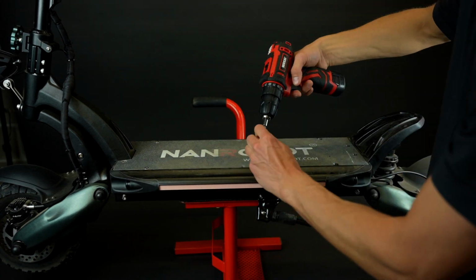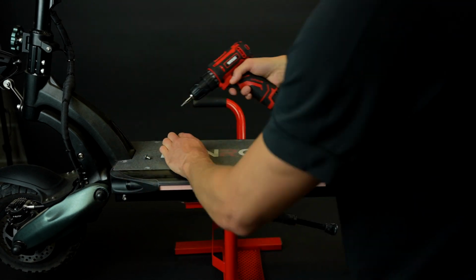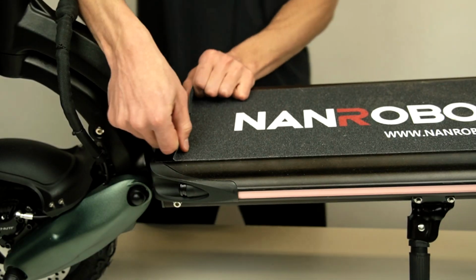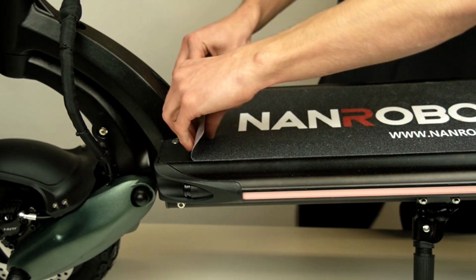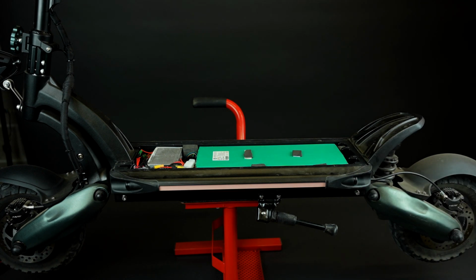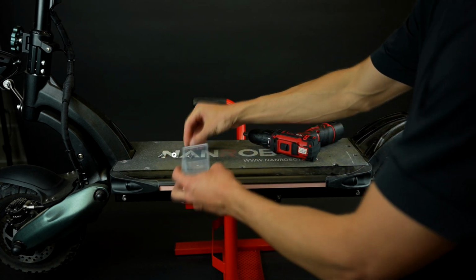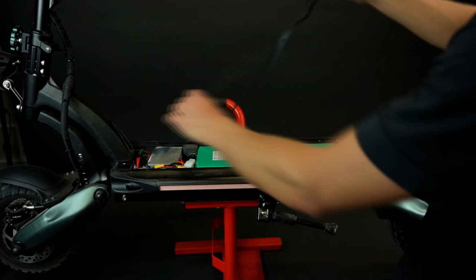Now let's get started. Lift your scooter and remove the deck cover. If you don't know how to remove the deck cover from your scooter, we have a separate video on that on our channel. You'll find the link in the description below. Remove the deck cover and the rubber gasket. During this entire process, make sure to put all your screws, nuts and washers in the box so you don't lose any of them.